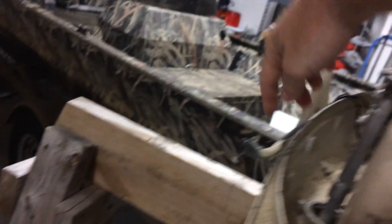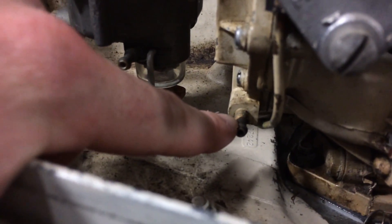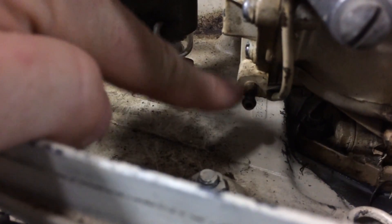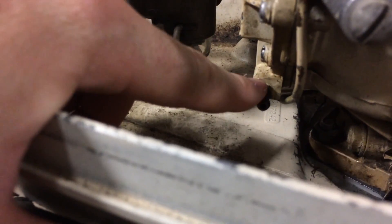The fuel siphons through this fuel connection — in one side and out the other — and runs around here and into this. The old nipple will no longer be used, so you need to block it off. Take a short piece of fuel line, slide it over there, put a band clamp around it for a good seal, then screw a big screw into the other end to seal it off. That'll keep the pressure in there.